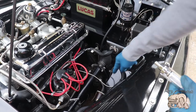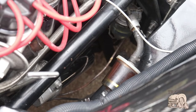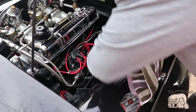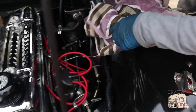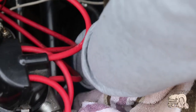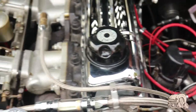What I'm gonna do first is open this line up and let some gas drain out — I want to see how it flows, so I'll get my bucket and come back to that. I'm gonna stuff something under here to prevent gas from spilling everywhere. I also had a suggestion to open the gas tank to check flow, because the vent pipe on the gas tank could be clogged — the car does sit through the winter and anything could have crawled in there.